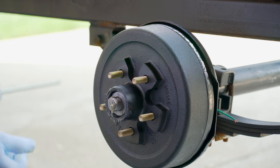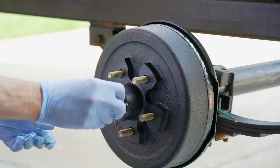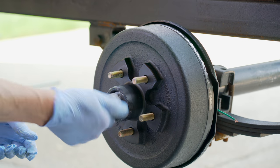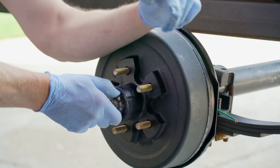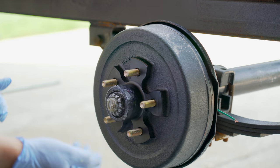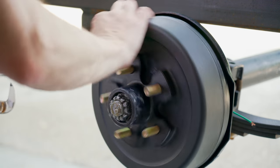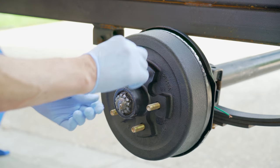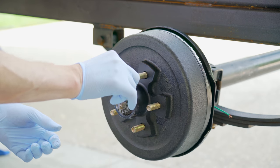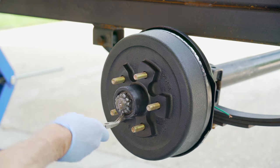The smaller bearing goes in there completely covered in grease — it will fit snug — and then you will have a washer to go over top of the bearing. Now the castle nut needs to be installed. Grease up the castle nut; it will not require a lot of tension. I give it a little bit of a torque with my channel locks and then turn it back just a bit, making sure the wheel can spin freely. Then you need to line up the castle nut so that it aligns with the hole in the spindle for the cotter pin. Once you have the cotter pin through, you need to bend it over and back in front of the spindle exactly how it was when I removed the original one.